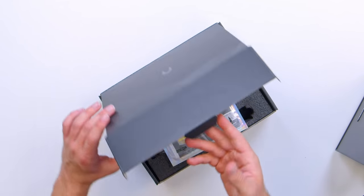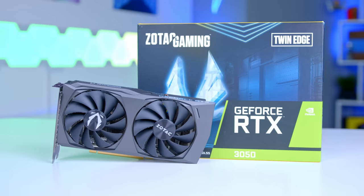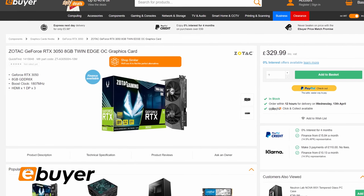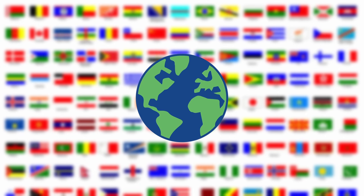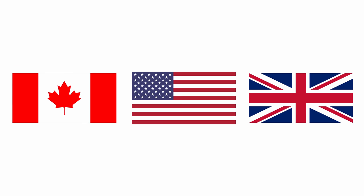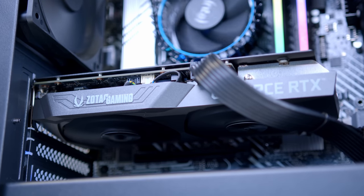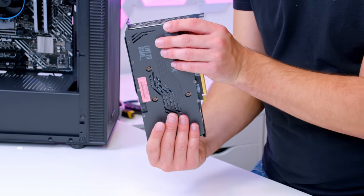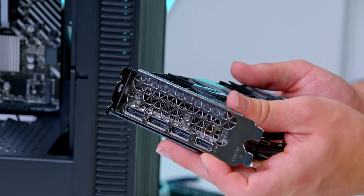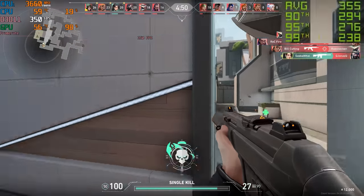The new RTX 3050 was the perfect fit for this system, and I've been keeping my beady eyes on pricing and availability all around the world. Here in the UK, Zotac's twin-edge design is the best value 3050 that exists — on eBuyer here in the UK, you can buy this for a sliver over £300. In the UK, the US, and Canada, you can buy a 3050 for a price that isn't ridiculous, very near MSRP. This Zotac design is just a perfect balance: a nice two-fan cooler with heat pipes to disperse heat, a metal backplate, three DisplayPorts and HDMI 2.0 on the rear panel, a single 8-pin power adapter, and some factory overclocks for a nice performance boost.